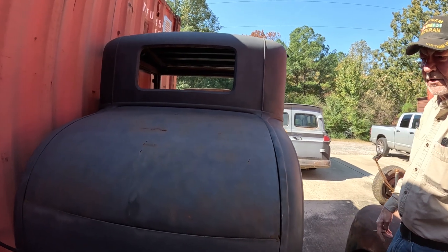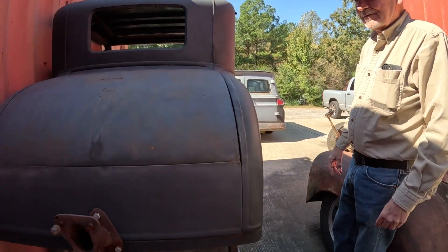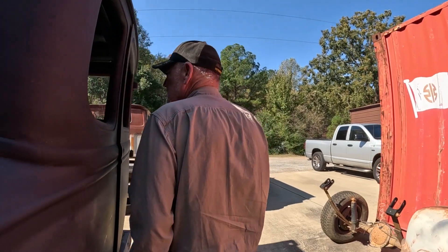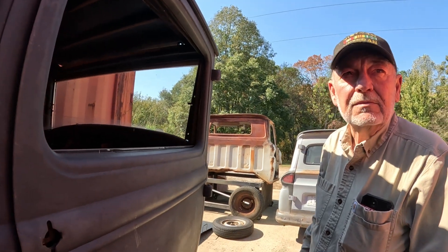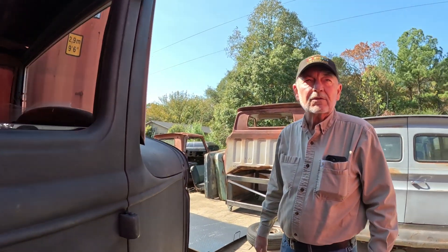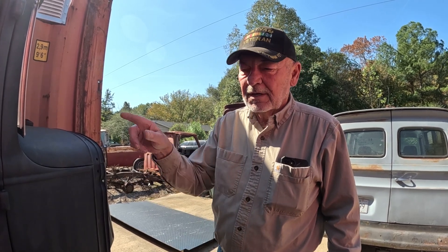It was such a good old solid body, I couldn't pass it. What is this — the bumper? That's a spare tire mount. I've got three or four of those; I don't know why I wind up with them — nobody uses them except people that build Jennies. I've got to order all new glass for it, a new windshield, because I want safety plate instead of tempered. Is it pretty easy to get glass for these old cars? Oh yeah, it's all flat glass — go to a glass shop, give them a pattern and say here's what I want. That sedan in there has got an amber tint in it. I took the old glass that was in it down and he just cut out new ones for it, then I put them back in.